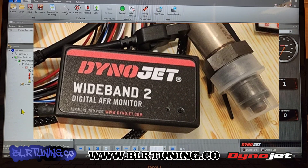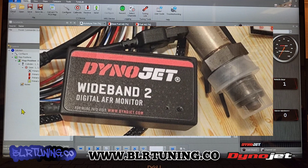The WB2 has a green wire coming off of it that is for a narrow band signal, so that would go in place of your factory O2 sensor to the ECU and tell it what signal is coming in. It's programmable so it does quite a bit of different features. Some you may use, some you may not. You can plug in an AFR gauge, you can plug in a Lambda gauge. So not only is it Auto-Tune, it's also wide band.